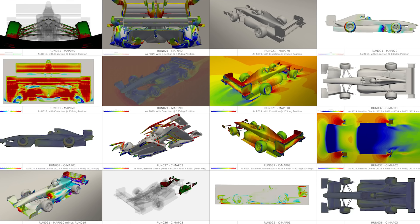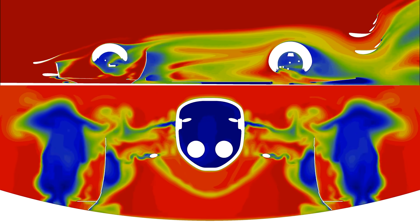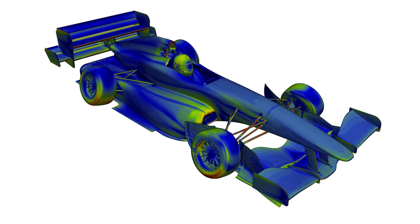That 80 mph figure is not only important for the length of the tunnel but also for what happens if things go wrong — it's much better to have an upside-down crash at 80 miles per hour rather than 150. What did Willem's design process actually look like? They did 38 configurations, with five attitudes for every configuration — that's 190 individual CFD runs. Because it's no good just understanding how the car behaves in perfect conditions; you need to know what happens in a tunnel, with a crosswind, with a ride height change, when the car is turning, and in the worst-case scenario.